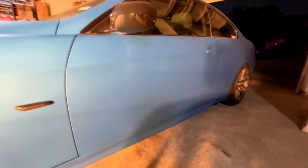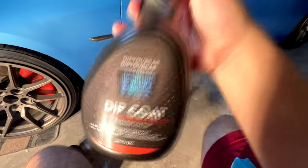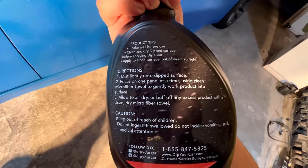Instead of removing the drip marks, I just kept going due to time constraints. Another setting to stay away from is the horizontal spray pattern setting on the tip of the gun — I thought I'd get better coverage by switching back and forth, but it only caused a bit of tiger striping on the passenger side of the car. But other than that, using the spray gun is actually pretty easy.